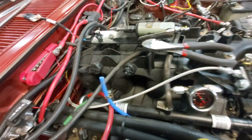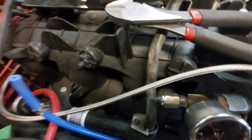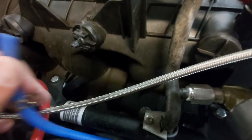I just wanted to show you the vacuum port that we opened up here on a factory truck intake. This is the extra one they give you, but it's covered up. So you basically have to open it up with your side cutters, and I just cleaned it up a little bit with my air grinder. Give you a close-up view here — so there it is.